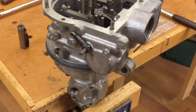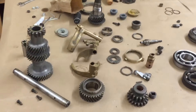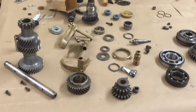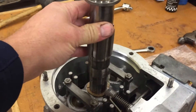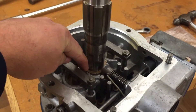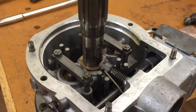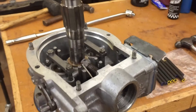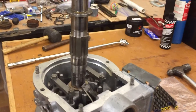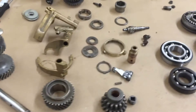It's come along great. I would have never known I was capable of doing this. Next will be the gearbox. By the way, if you're going to do a gearbox and an overdrive like I did, I think I dodged a bullet when I started with the overdrive first. The reason being — I have this main shaft sitting free and I'm able to line up way down inside there. There are some splines that need to be lined up, and I have no idea how you would possibly do that without a drive shaft. And I wouldn't have had a drive shaft handy had I not taken apart the gearbox first. Those things are really expensive and I don't plan on having a spare around. So that was a happy coincidence.